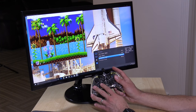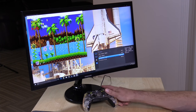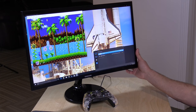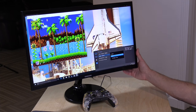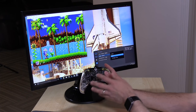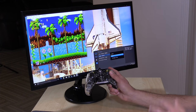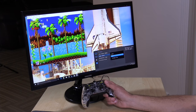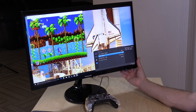If I'm running Sonic the Hedgehog here, you can see that very slight lag as I'm pushing the button — not much, but it's there if you are sensitive to it. You can go into the picture settings and turn game mode on, which disables all of that image smoothing. You'll lose some of the nicer image quality for text and graphics, but your games run a lot better because you eliminate that lag. It's very minimal, but you can turn it off and use game mode — and that's something I haven't seen on many monitors. It's on a lot of televisions, but not on many monitors.